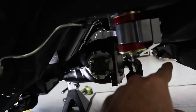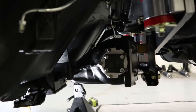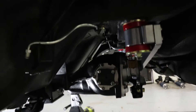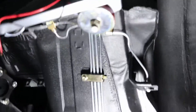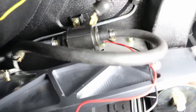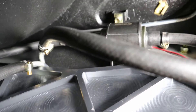We've got the diff in now — everything's all in. I'm missing a bolt at the front but I'll find one and get that back together. I want to get the arms in and then maybe the suspension, but we've got to get the bearings pressed into the bottom of the struts, so I won't do that today. One little problem we came across was my fuel pump bracket fouling on the Techno Toy Tuning moustache bar, so I've just modified that and pushed it up a little higher.